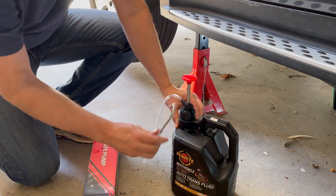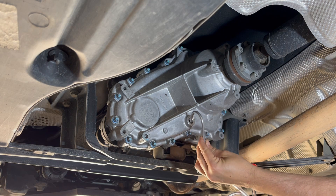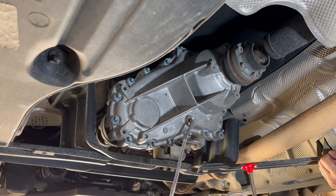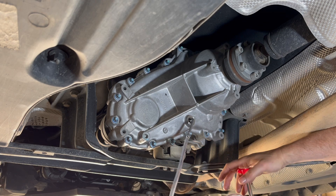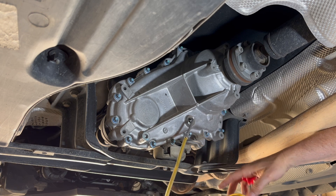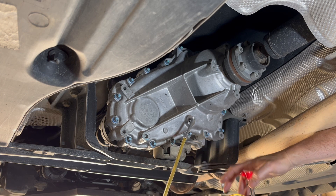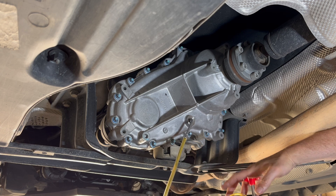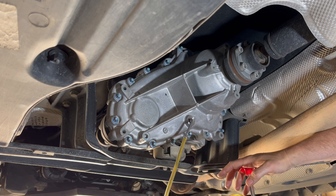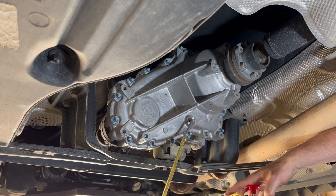We can pump that fluid straight out of the bottle without having to transfer containers — just fantastic. Get the Little Mate pump into the fill port. This is only going to take half a litre of fluid. You can see the fluid going in — it's a gold color, but that's because this specific brand covers all the MB specifications, both blue and red. It's a multi-purpose fluid. If you're using traditional fluids, it should be the red colored MB fluid — the MB236.12. All fluid specifications will be in the description.